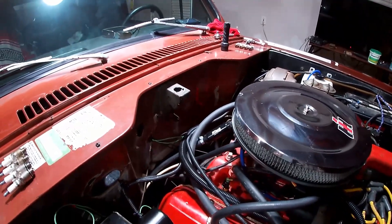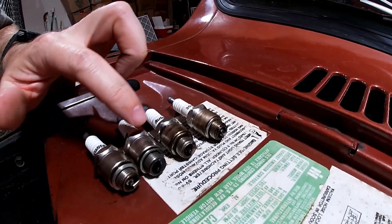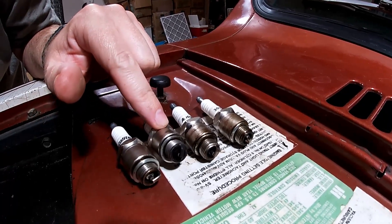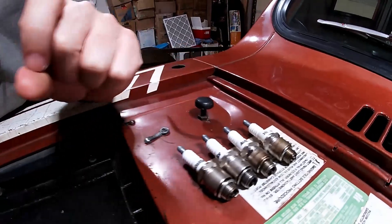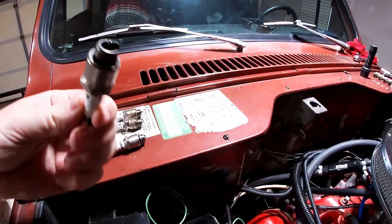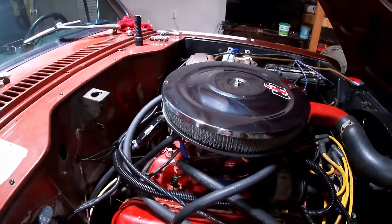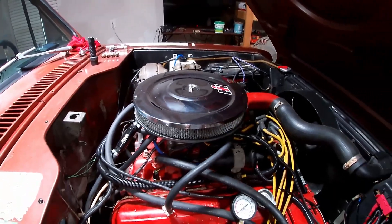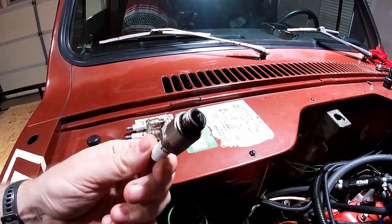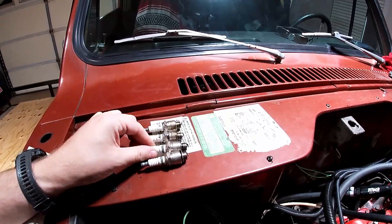Probably no one ever would have dreamed you'd be able to do that. But if you look at these — so this is two, four, six, eight — four's definitely much worse off. It's cleaned up a little bit because I cleaned it to do the test with the plug wire change, so it doesn't look as bad as it normally does. Normally when I pull it out it's very sooty, wet, and smells like gas — like it's not firing at all.